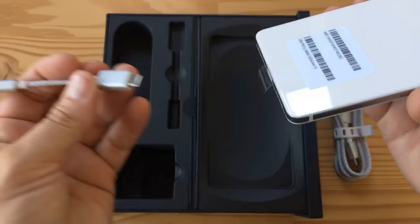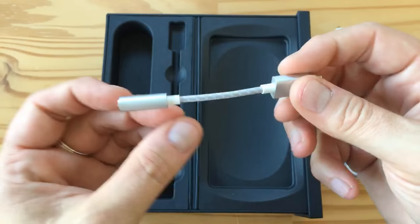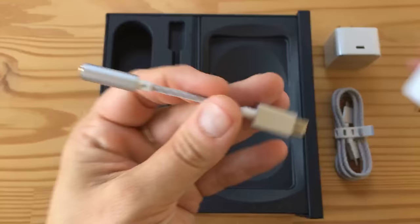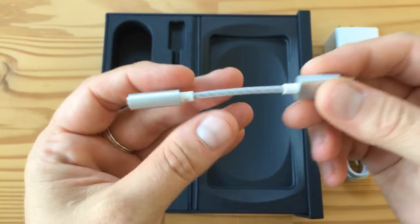And then there's digital adapters, which this is, which the U11 uses, U11 Life. Watch my U11 Life review. It's just the previous video to this. And the Pixel 2, of course, has this. Watch my Pixel 2 reviews. So those three use digital adapters. It means there is no DAC or headphone amp in the phone. It's all in the dongle. So these are more expensive and complicated dongles. So the Essential, like the Pixel 2, like the U11, has an active digital dongle. So very much like the Lightning dongle from the iPhone, which has all the electronics in it.